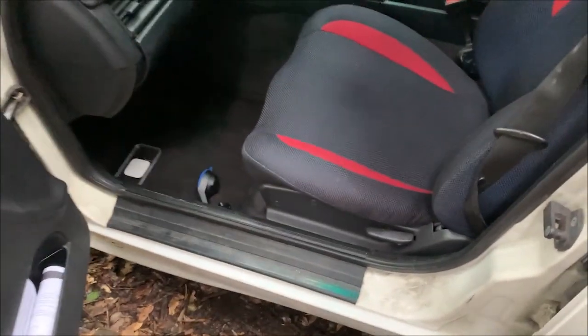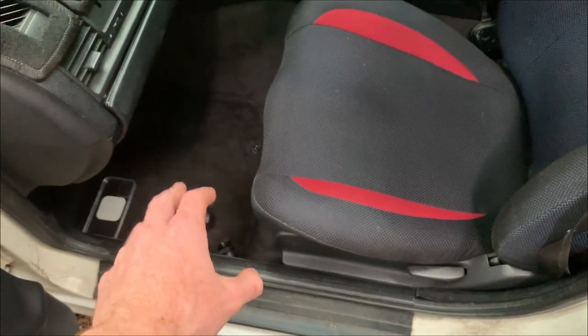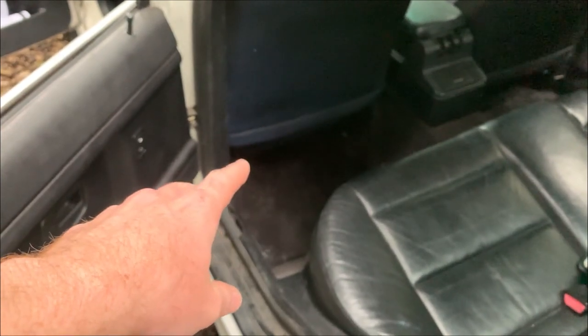Oh yeah, I'll walk you guys through it a little bit. It's a stock mounting style on the front with the studs. You won't be able to see it, but on the back, in order to install these seats, you've got to slide them in and then drop the front down onto the studs, because how I've designed the mounts is a little bit tricky. Everything's really close, so it's hard.